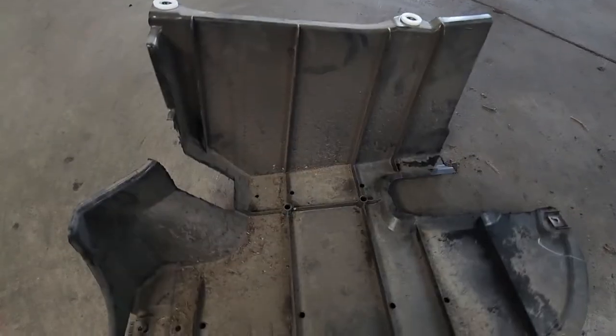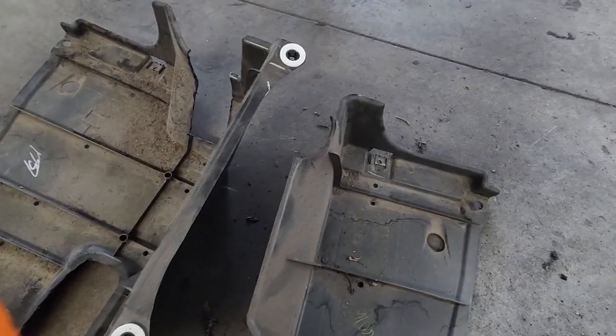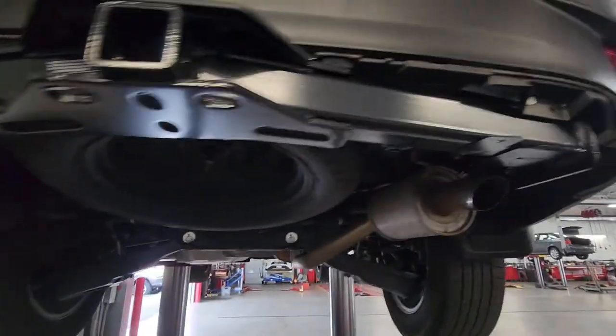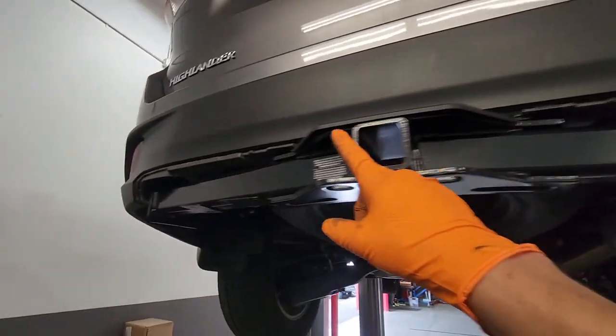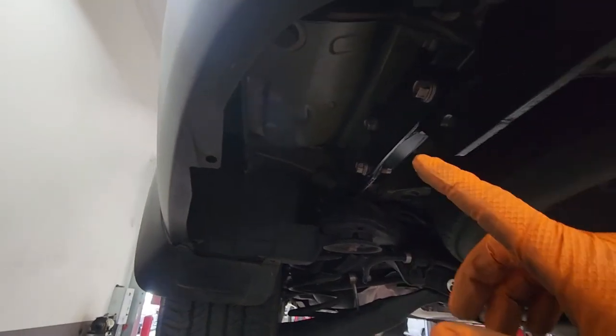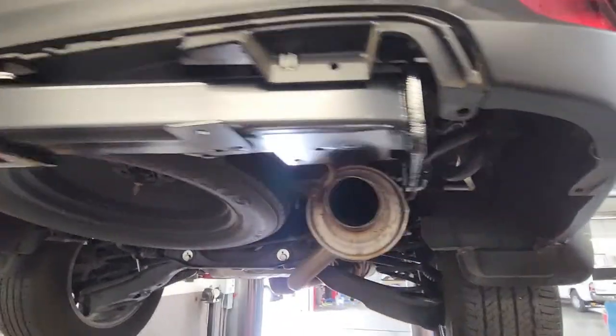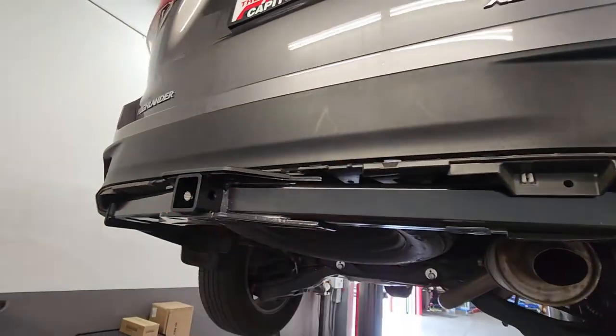There's what they look like when they're all cut out. With those pieces cut, we'll go ahead and reinstall both sides and then install the bezel trim that goes right here. This customer is not doing a wire harness, but if you are, you'd come out through this grommet here with the factory harness — it clips there and comes along here and bolts up. Since we're not doing that, we'll reinstall the cover and then do the bezel that goes across there.